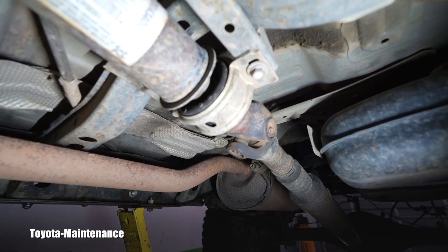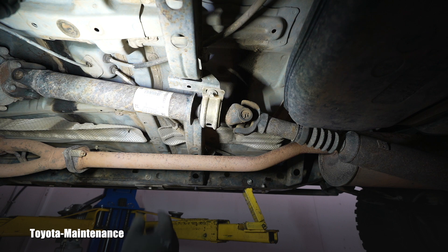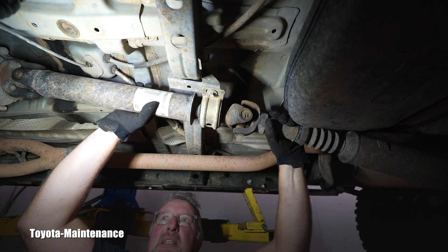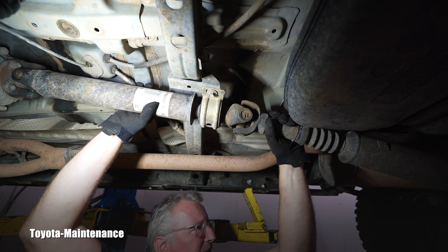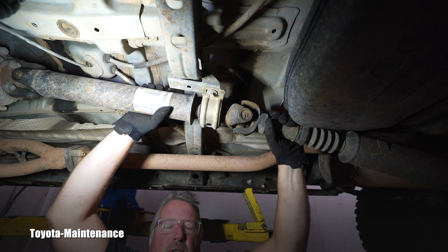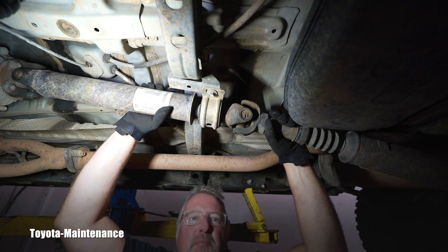There's one more item you have to look at: the support bearing. Check that support bearing — it's very easy. You can look inside with a light, changing the direction of the light, or you can just grab it and check for play. And if you find what I have found, you don't have to question the other areas — you can confidently go for replacement of the support bearing.